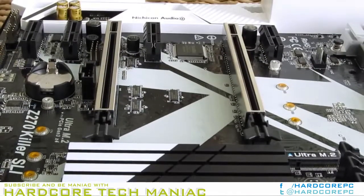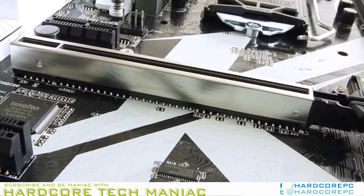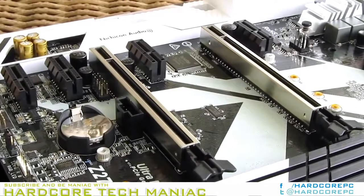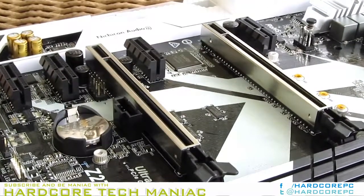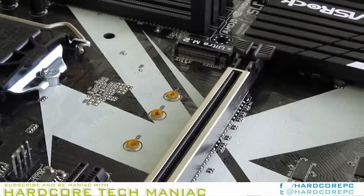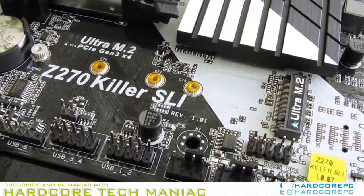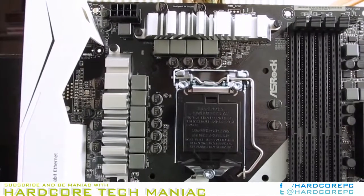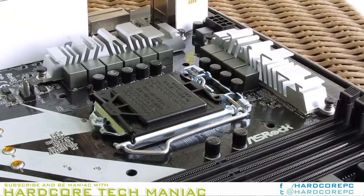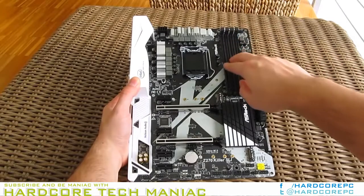Other reductions include LED lighting only for the PCH sink, only a single large RGB header for case fans, and the board is even cut to 8.8 inches, 224 mm, deep, down from the ATX standard of 9.6 inches. That means it won't reach the third column of standoffs in your ATX case. Simplicity has eliminated most other potential fitment concerns, though the front panel audio connector is pushed all the way back into the corner, where the cables of certain poorly configured cases won't reach. At least the USB 3.0 connector is above the top slot, so that it won't block any cards.